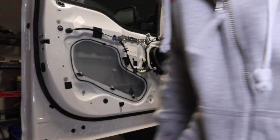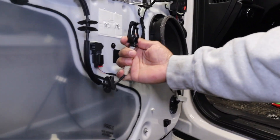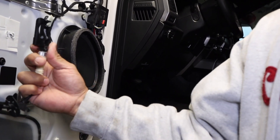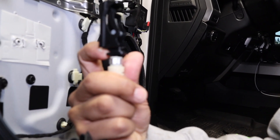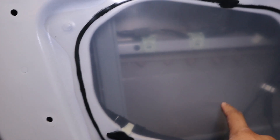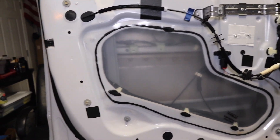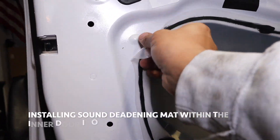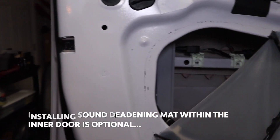In the back you're going to have to release this cable and remove all the connectors. So let's talk about this cable because this is going to save you some time. This cable is going to be on your door panel — what you're going to do is use your finger, press this tab down, it pops out. We're going to have to remove this, which is fine, because our sound deadening is going to go across it. We'll have to install some sound deadening on the outer door so go ahead and remove this.